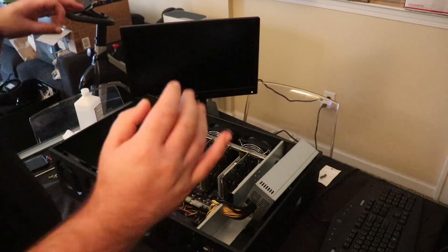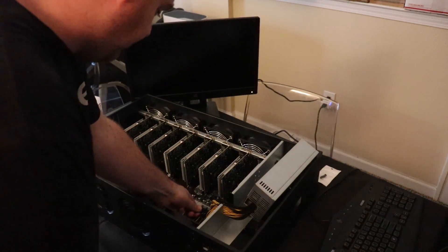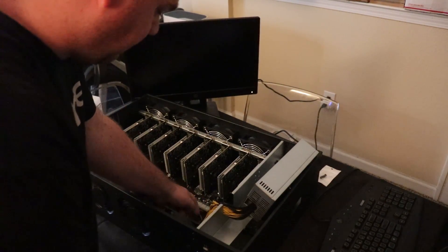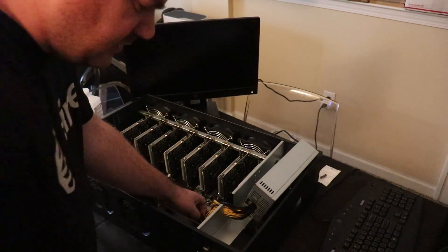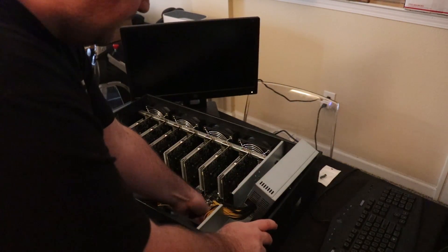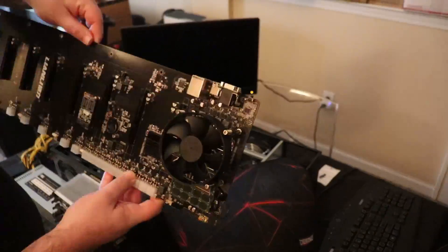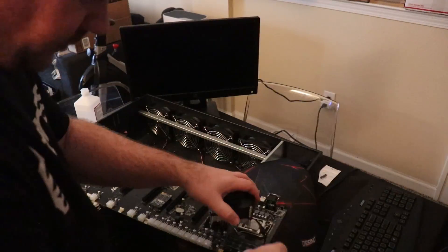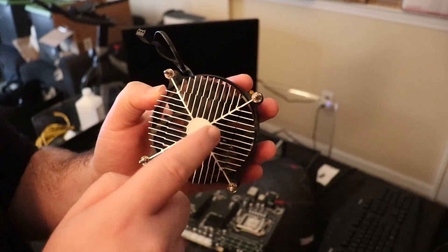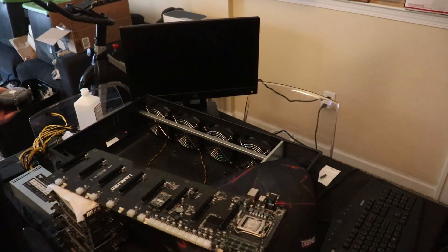Let's go ahead and get all of this taken apart. We're going to get the motherboard out so that we can start working on it. Technically you could probably do the swap with the motherboard installed, but we're going to remove it because it's going to be easier, especially going with an aftermarket heat sink — we'll probably need to get a back plate underneath the bottom of it. We're going to undo the fan, and here we can see the heat sink. Right off the bat, look how tiny that surface area is for our thermal compound — it's essentially nothing. That definitely would not work with an i7.